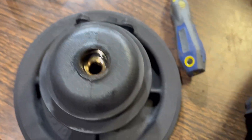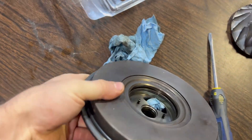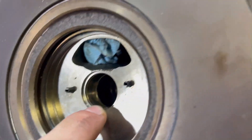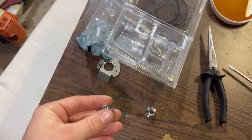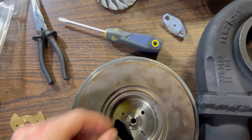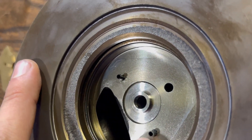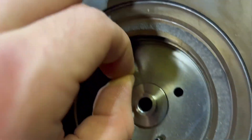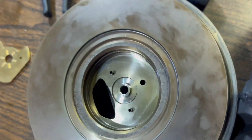Obviously stay as clean as possible when you're doing this. Now flip the whole turbo over and do the same on this side — journal bearing sandwich, make sure you coat it in oil. Next you're going to have the thrust collar, and that just goes in like that, sits right on top. The kit comes with these as well. I usually inspect the pins, make sure they're tight, and if they're fine I just leave them — that's up to you whether you change those.